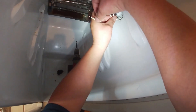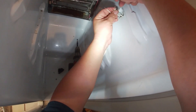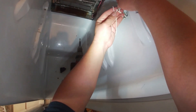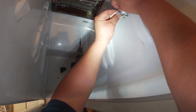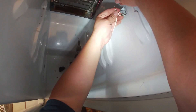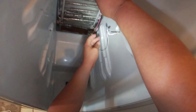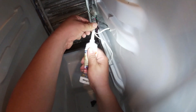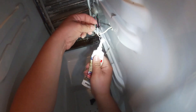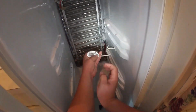I had it in there for a long time, so that means this thermistor is not good — and this is our issue. We explained the situation to the customer and the customer decided to replace the defrost thermostat, this thermistor, and the freezer thermistor for preventative maintenance. But I'm going to show you everything we did in this video. If your temperatures are crazy, start by replacing this thermistor you see me working on in this footage.